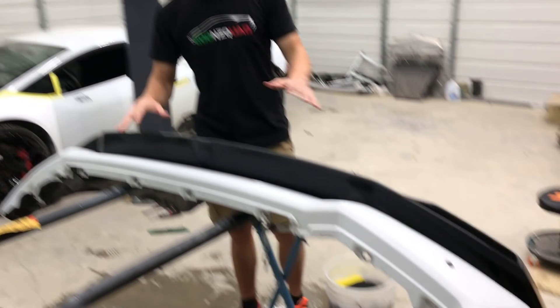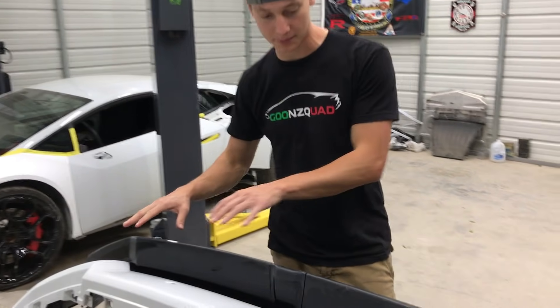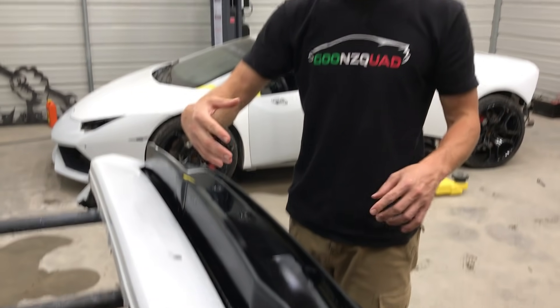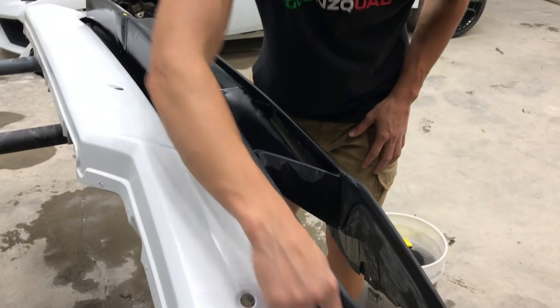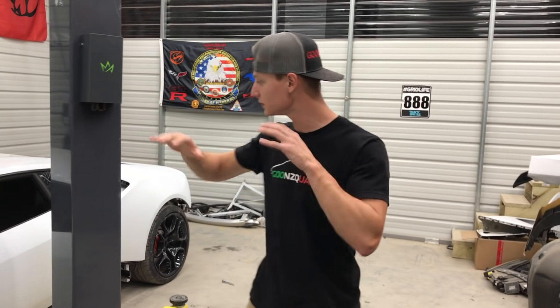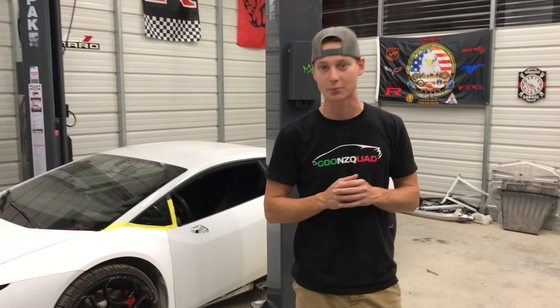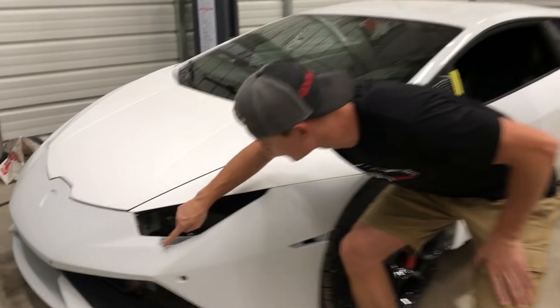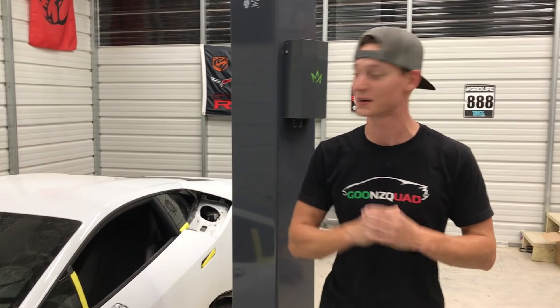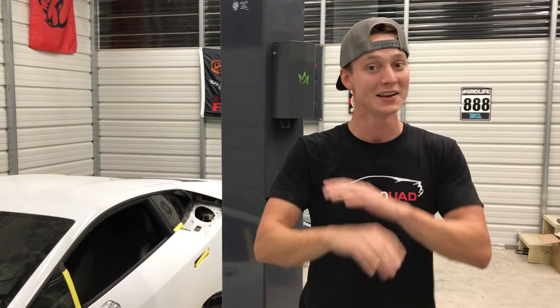We just finished up wet sanding this rear bumper. We went ahead and sanded this matte black area too, so when we're spraying the white we do not have to mask this area off. Later we're going to mask off all the white, do a nice fine line, and then spray this separately with a matte black finish — that's just the professional way to do it, that's how they do it at the factory. We are moving right along, but it did get late on us because we had to take care of some business — something absolutely amazing, maybe a new build. You're just going to have to stay tuned.